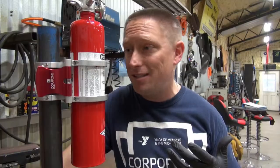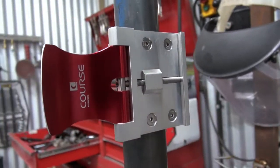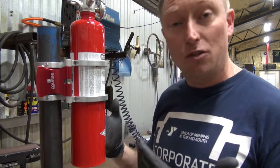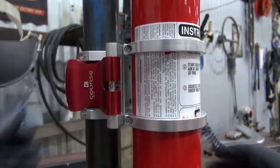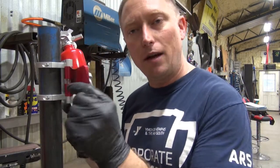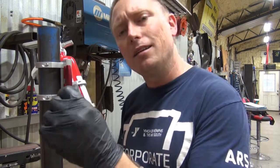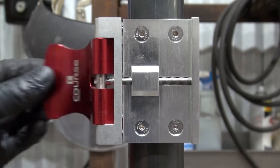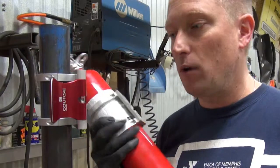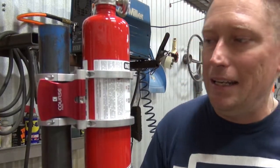This thing is solid CNC machined aluminum. All of the fasteners on it are stainless steel and it's just so simple and works so quick and easy. You pull on this little tab on the side and the fire extinguisher comes right off in your hand. The little handle, which you can get in several different colors, is set up on a cam clamping action, and the screw that operates it is fully adjustable. The thing comes right off in your hand and putting it back onto your roll cage is super quick and easy.